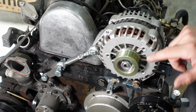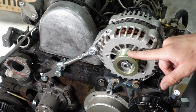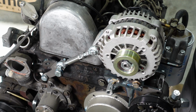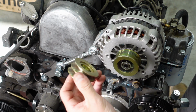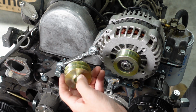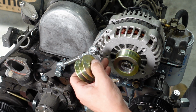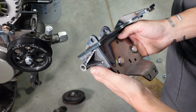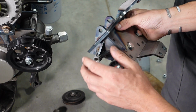This alternator comes with a 6-rib serpentine pulley, so it's ready to go with our serpentine kit. If you need to switch it to V-belt, you have to run a dual V-belt pulley, and so that part number and link is in the description below. This just bolts on.